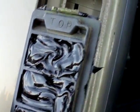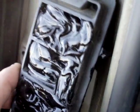This is the second ZJ I've owned, and I just fill all the louvers full of silicone, and then silicone around the outside edge — excuse me YouTube, let me get you in here. Silicone on all the louvers, silicone around the outside edge, front and back. It says 'top' right there — can't get it wrong. Just pop it in there, push it in real good, move it around a little bit, and that silicone seals up.